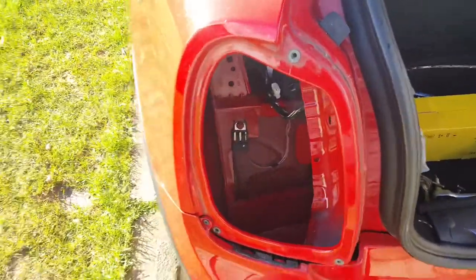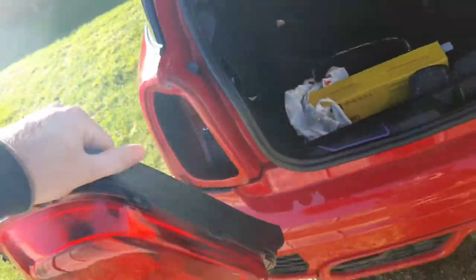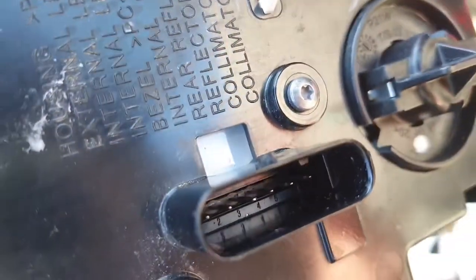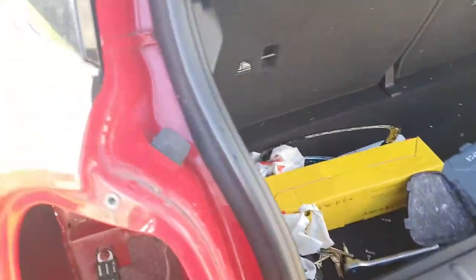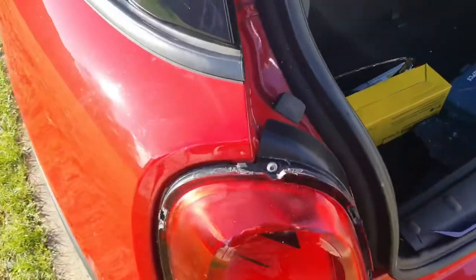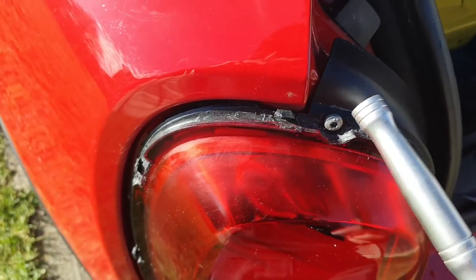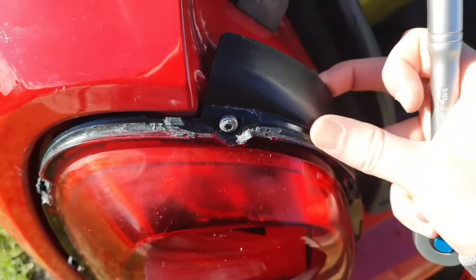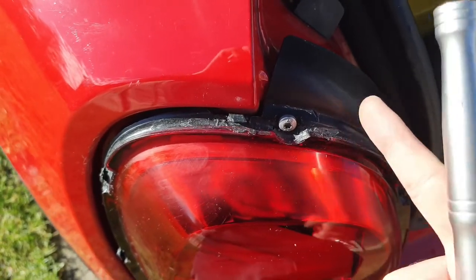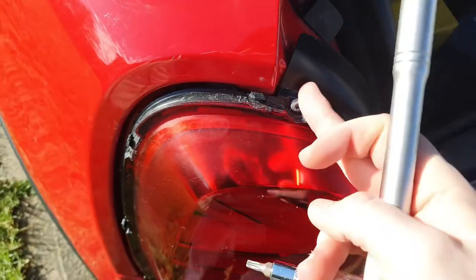Once you've done the rewiring, grab your new Union Jack light — preferably the one for the correct side of the car. This is the one I've resealed. Connect up the connector into the back — it'll only go one way because it's got a little groove sticking out of it. Then screw in the T20 screws. Just a note: it did take quite a while to screw in the top one, and I think that's literally just because the foam packing has to compress behind the screw. It looks like it's not getting any closer to the bodywork, but it's just compressing that foam to make it watertight at the back. Just keep screwing until it gets a bit tighter.